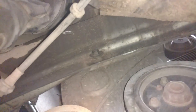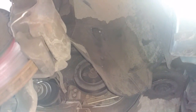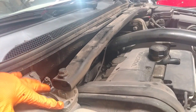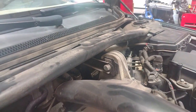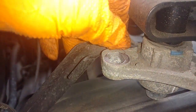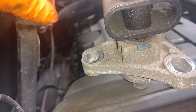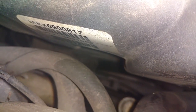Pulled the wheel off. I opened up this splash guard and put the bolt right back on the nut on the stem so I don't lose it. Now I'm going to lower the car and pull the top front cover off. Pull your stabilizer out of the way — two bolts here, two bolts on the other side, and that bolt in the middle. These bolts are 14mm on each side, the middle one is 18mm, and you've got to undo this little clip here so you don't bust it before you lift that out.